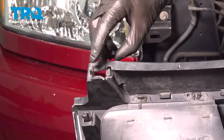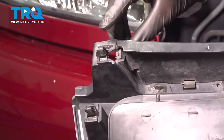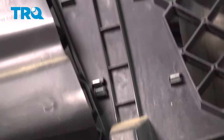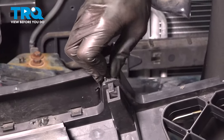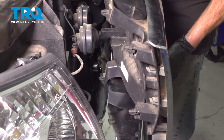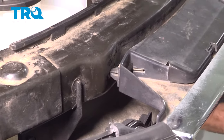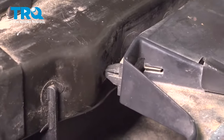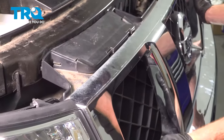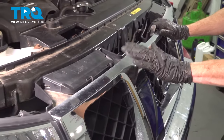Now it's time to take those clips and put them in place in the grill. This is going to be very simple — just take it and slide it all the way over. Do the same to all of them; there are four across the top and three across the bottom. Once you have all of those in there, carefully slide the grill into place, making sure that you align all of your alignment pins with their corresponding holes. Once you feel they're all lined up, slowly press this in, being very careful not to damage the grill. Give it a wiggle to make sure it's completely secured to the vehicle.